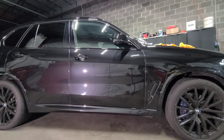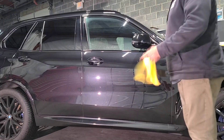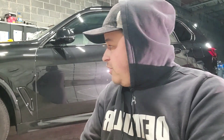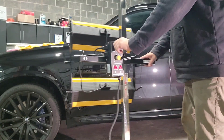We're done removing the coating off of the passenger side of the vehicle. Usually about five minutes after I do this, I'll apply the infrared shortwave heaters onto the panels to make sure that the coating cures fast, so that when the vehicle is delivered the wait period is much shorter. What I do is I just take the light, bring it over here, and maximize the timer.